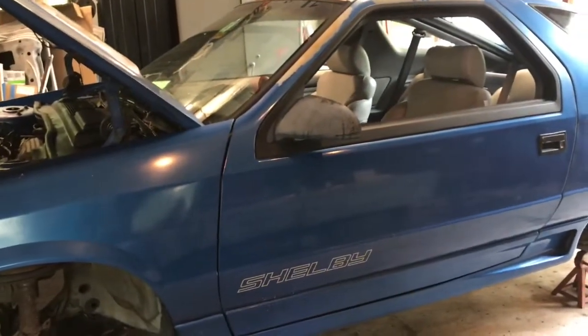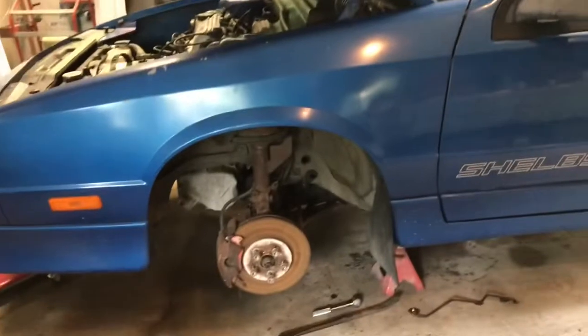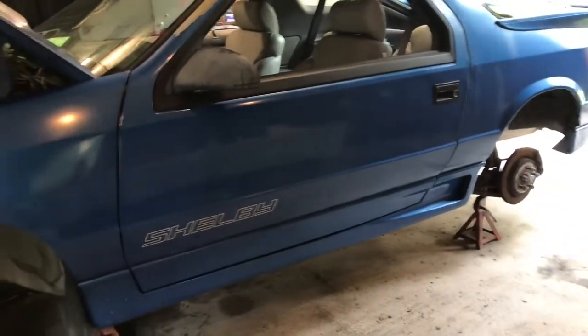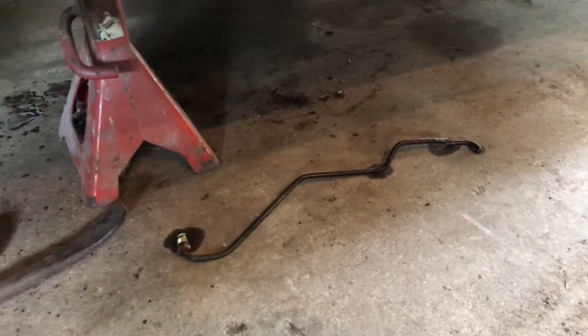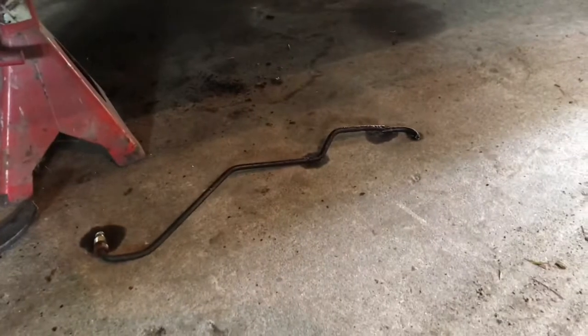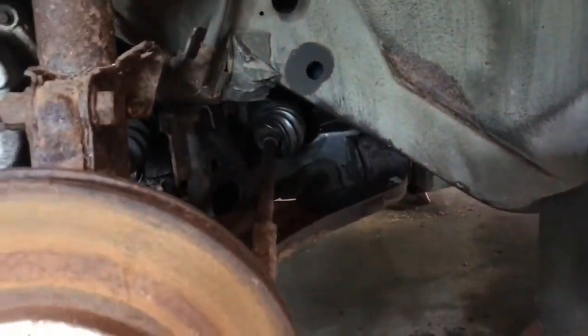It's the next day. I didn't get a whole lot done yesterday — took a break for dinner and then lost interest. But it's up in the air. Wheels and tires are all off it, and I've got the brand new tires installed on the wheels. I'll show you those in a second — that was a smoking deal. I did get one power steering line off. That's not one of the main lines, but there's a main pressure line to the rack from the pump, a return line, and also two lines that go across the rack. That's one of the two, and I'm going to replace both of those. It's not a fun spot, and it's a really dirty job because the line blew and it blew power steering everywhere.